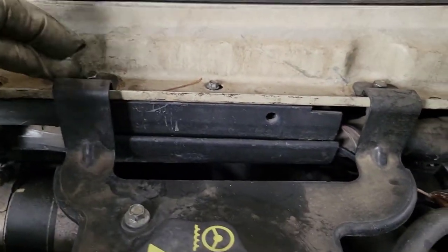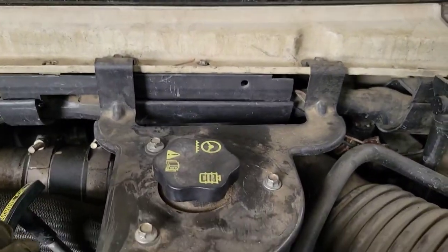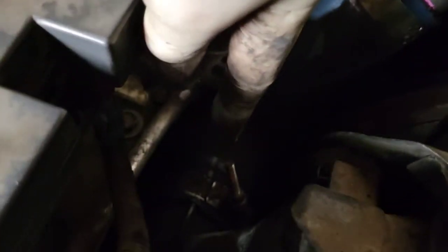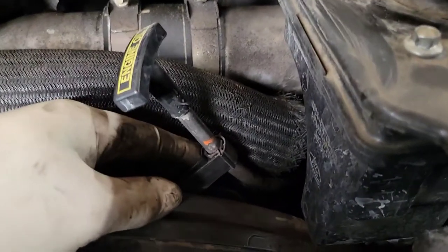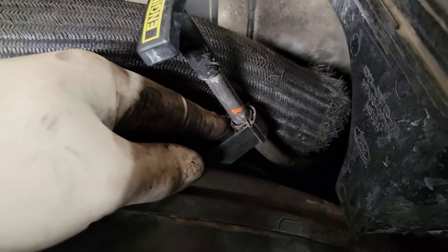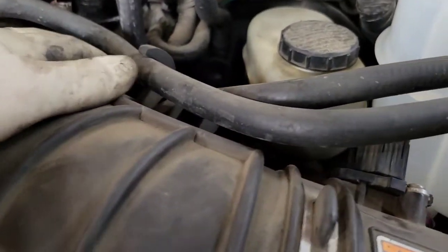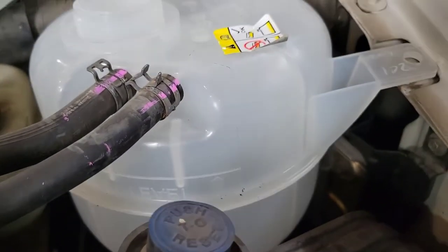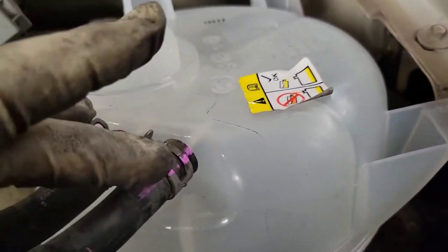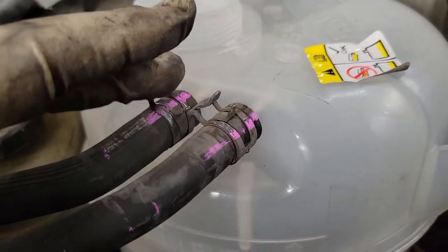You've got three bolts here and two bolts here. Take the cap off, undo those, the bottle falls out, pull the bracket off, then put the cap back on. You've got your two radiator supports — two tens. You've got your CAC tube here back on the intercooler. You've got your upper radiator hose here, your engine dipstick popped back into its plastic clip, your intake tube here, and the rubber hose that goes from the radiator over to the degas bottle.